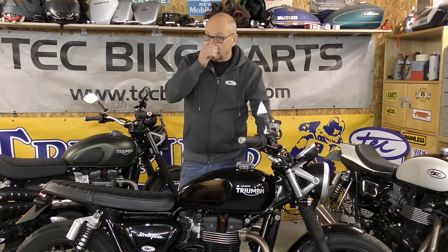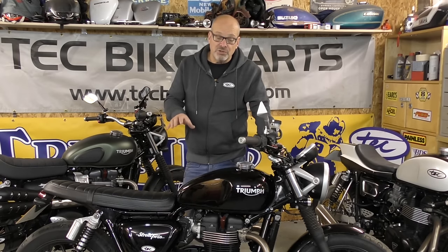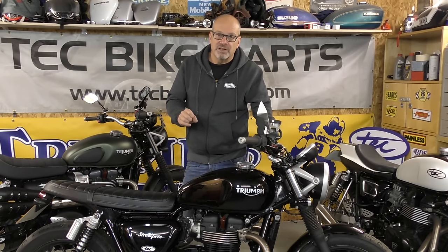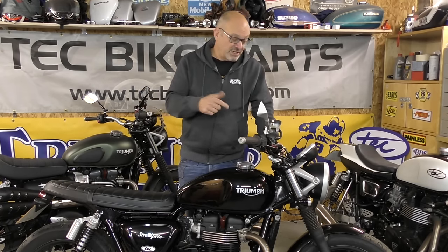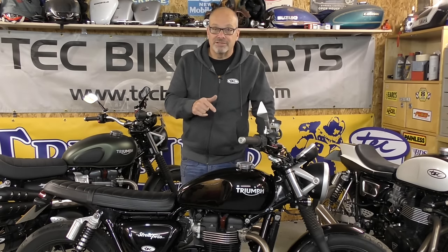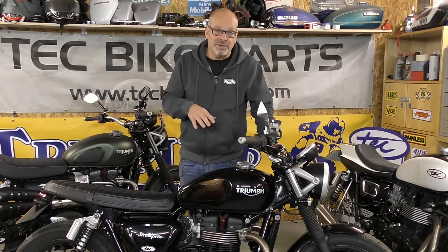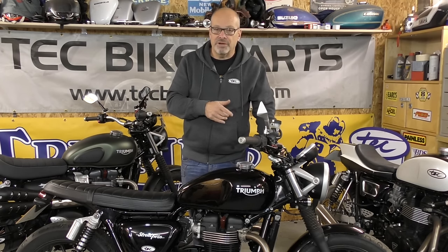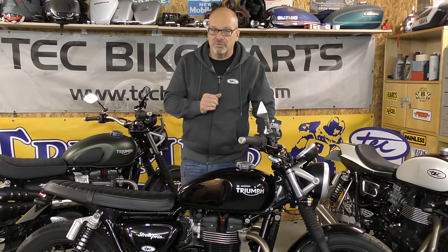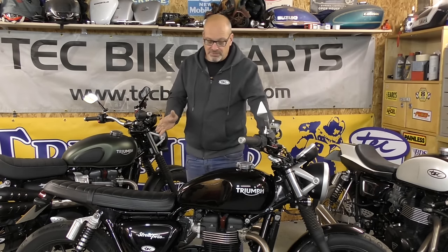It's not really economically viable to go further, so I think the power performance we've achieved is a good compromise. And it's not just about power — this bike rides much nicer than when it came from the factory; it hasn't got that nasty drop-off in power. One downside is it is significantly faster now, and the next upgrade is going to be on the front brake — the standard two-pot caliper really isn't man enough for the speeds this bike will do now, but that's easily fixed by dropping a six-pot caliper on there.